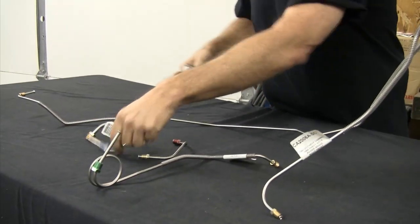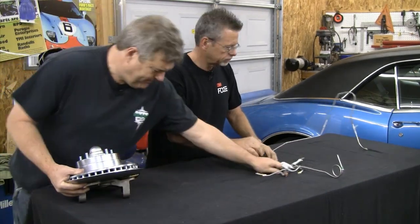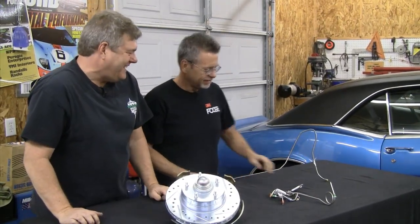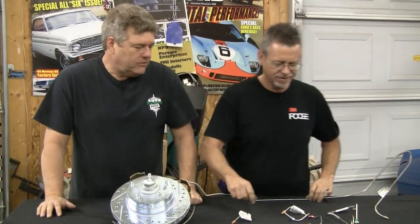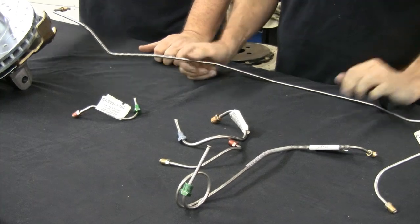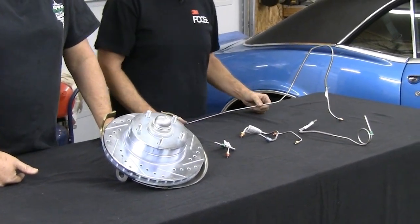I'm going to put some stainless brake lines in here. We're doing all this other work, so we may as well replace the brake lines — you know they're going to be cruddy and crusty from years of abuse. We got the classic tube set from National Parts Depot. If you're going to do one of these cars, you want to go in and replace the brake lines. The brake system on a 40-some-odd-year-old car — you're going to have an issue. We're putting this setup on the front now — drum brake on the rear, but we're going to put disc on the back later. We'll take care of the front now and add more when we do the rear.